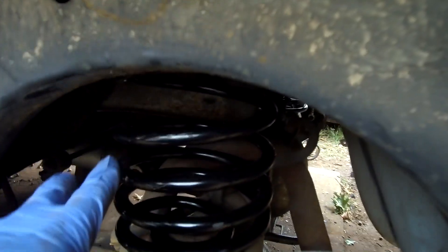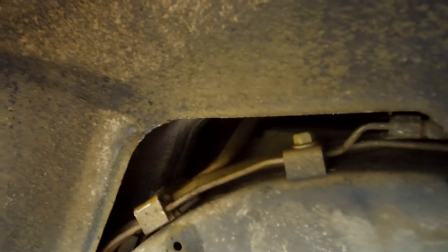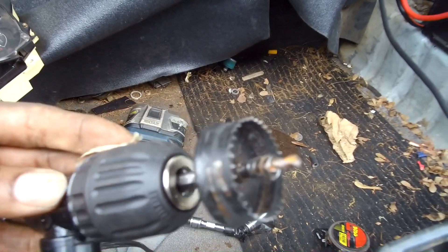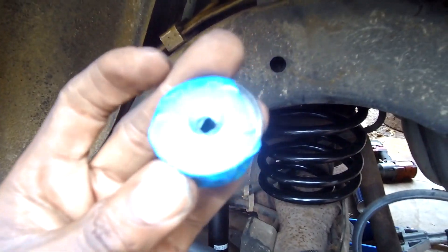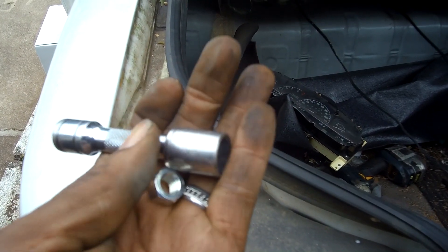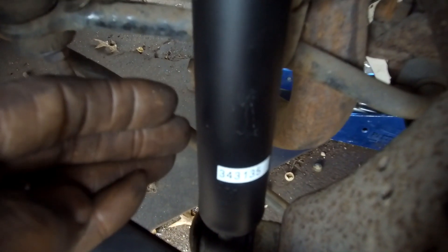Before we installed the shock, we installed the lowering spring. It is this number right here — CC501. Now after that you're dealing with a little bit of space right there to install the shock. You start cutting — you can use some other kind of circular cutting tool, but I'm using this. I got this angle tool and you make the hole. Make sure you use the stock situation from the Crown Victoria on the bottom end of the shock. Get this all situated, ready to go — you have your shock and it's all the way up in there. You can actually pull it down like this and then let the shock come in, and that's how you're going to sneak this situation right on in there. Got a little bit of thread on it so you can put a bolt on it. You're going to need a shallow end socket — put a little tape on it so it can hold inside there. You have to put the deep socket on it, and you tighten up the bottom bolt right there. And that completes your shock and spring install on your Crown Victoria.